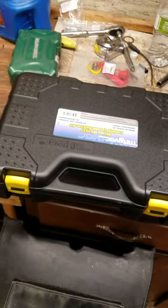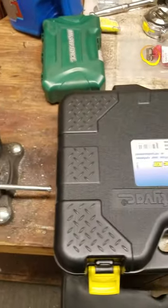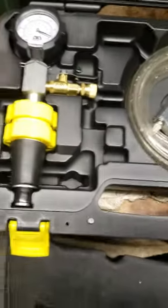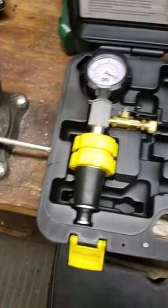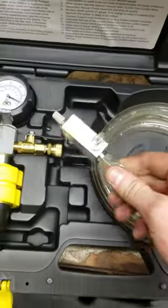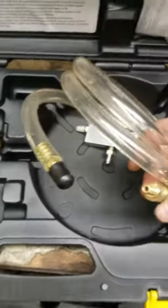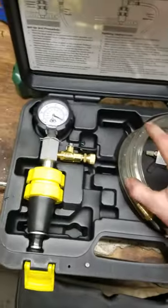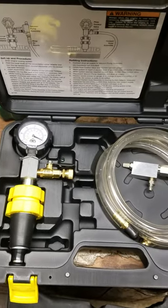Plus on top of that you check for leaks, because you run it up to a certain vacuum pressure and monitor that on the gauge. You unhook your compressor hose and watch that gauge for any changes. Then you simply take this guy off — that's for inducing the vacuum — plug this guy to it and dunk that in your coolant, open the valve back up and it sucks the coolant in. Once you hit zero your system's full. Works like a charm. I'm happier than ever.